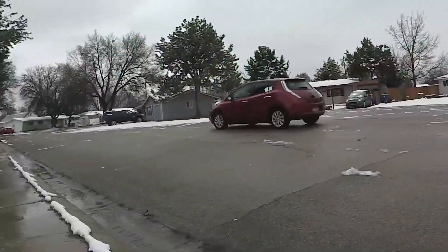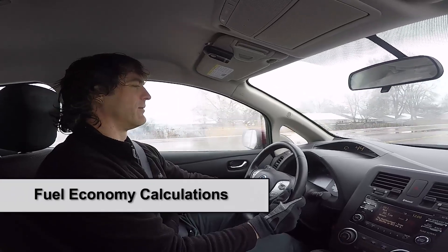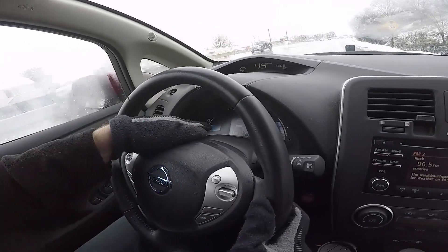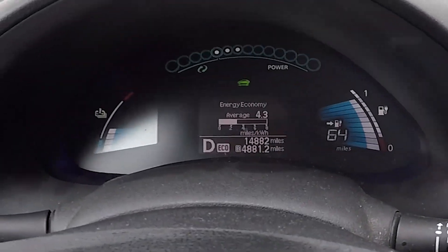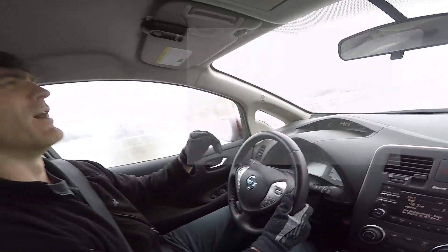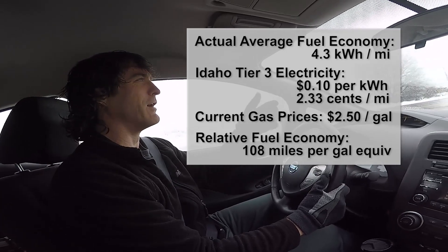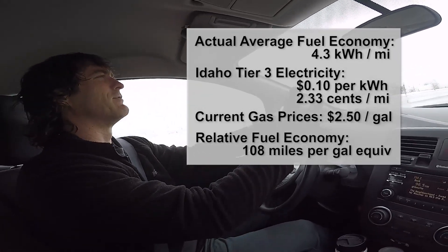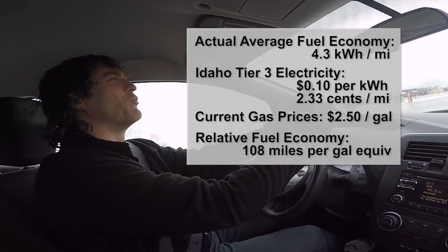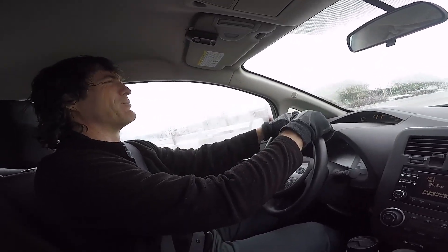It's all electric. I live in Idaho where power is 8 to 10 cents per kilowatt hour. My average fuel economy is 4.3 miles per kilowatt hour, so I'm getting roughly one mile for every 2 to 2.5 cents. Compare that to gas prices at $2.50 — I'm essentially getting 100 to 125 miles per gallon equivalent in terms of money spent to drive this car. Fuel economy is absolutely amazing.